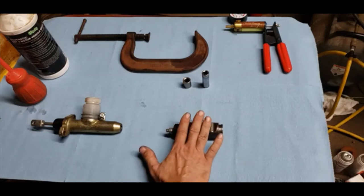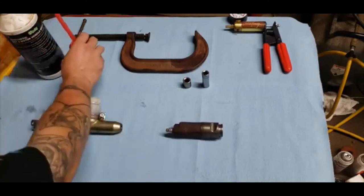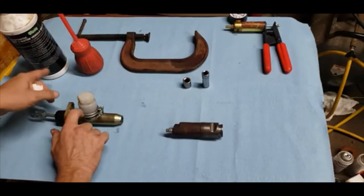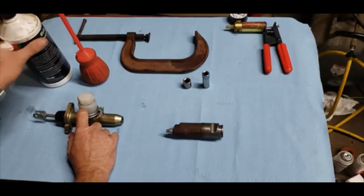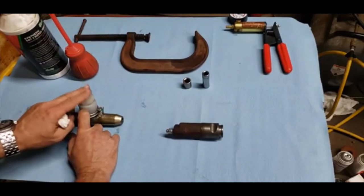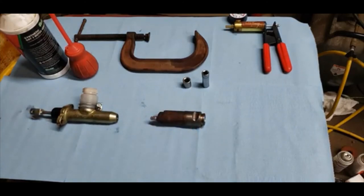The trick is that because the slave cylinder has a larger volume, we're actually going to work backwards — bleeding from the slave cylinder side, not from the master cylinder side. It helps to have an assistant because with the volume difference, you're going to be losing a lot of fluid and need somebody to do your refills. Communication is key — you don't want to introduce any more air into the system. Done properly, this should take no more than 20 to 30 minutes.